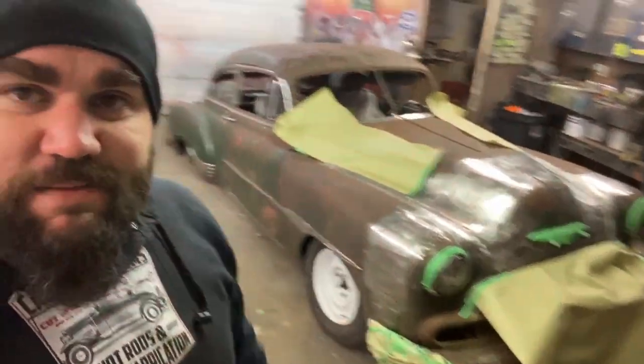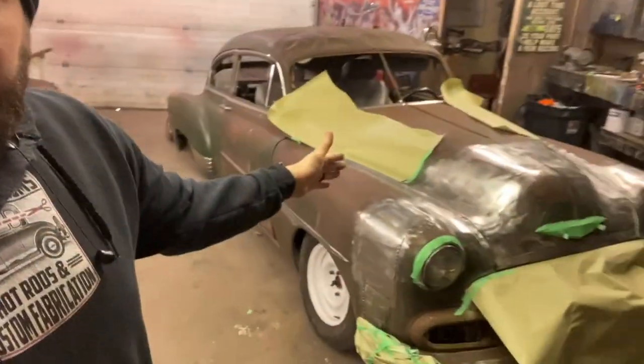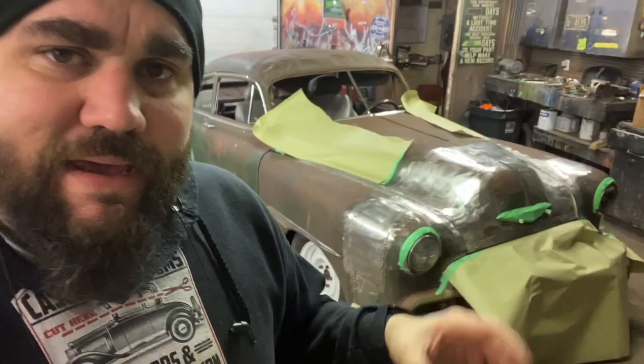Cool story — got it all taped off and ready for primer. Eastwood sealer primer: the best canned primer you can buy. It's an etching primer so it actually grabs onto the metal and basically prevents rusting. I was all excited — I knew I had a can left because Eastwood sent it to me — and guess what? It's empty, because my dad used it, and he's an asshole. Now some of you are going to say 'yeah but you stole his wheels' — whatever, that's water over the mountain range. He screwed us. So now I gotta go get more primer. I have some roll-on high-build primer left but I don't want to use that just for sealing, so I'm going to go to the paint store and get some rattle-can etching primer.